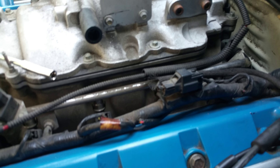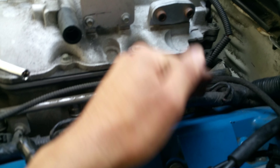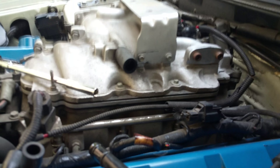Some of you are going to have the EGR tubing right here - I don't have an EGR delete, but you're just going to have two bolts right here. You can slide the exhaust port off and move it out the way enough where you can have no issues with that.